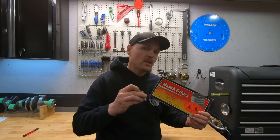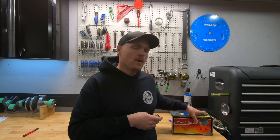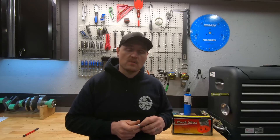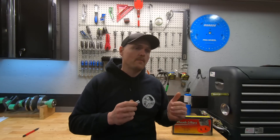Because what they claim is if you have marginal vacuum on your engine - so if you pick a camshaft that's too big - you're going to have low vacuum at idle. And what that can play a big role in is power brakes. So when I picked the camshaft for the 406 small block here, I used a calculation to figure out if it's going to be borderline for power brakes given the overlap. I knew it would have between 10 and 12 inches of vacuum, and I ended up having 11 inches of vacuum at idle with a regular Delco lifter.